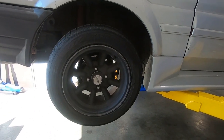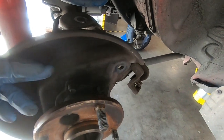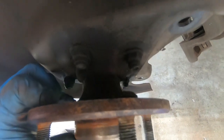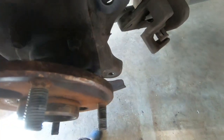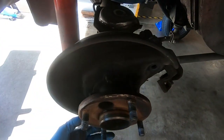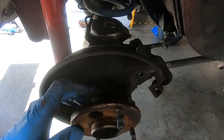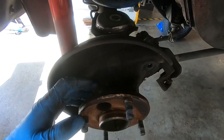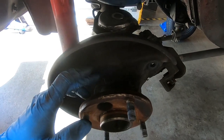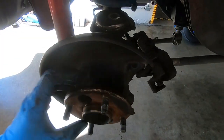We'll take off the wheels right now. Alright, we have the wheels off. I wanted to show you guys the slop in this thing — you can see that axle move in and out, so that tells you something's going on back here. I've seen before where these four retainer bolts for the axles have backed out, so it's important to note: this hardware is supposed to be one-time use, but just blue Loctite on these guys and good and tight should be good enough.